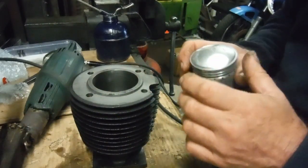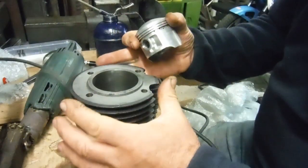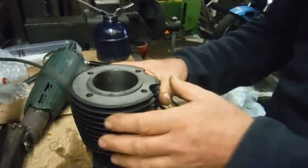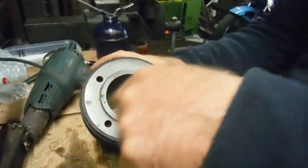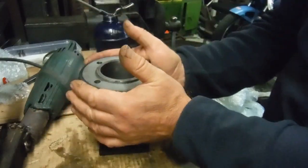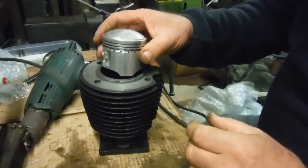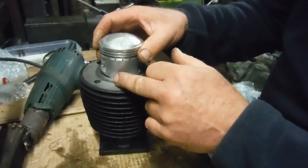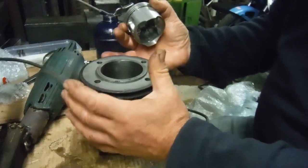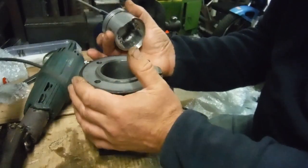This is a cast iron cylinder. Alloy cylinders seem to be less troublesome from my own experience on this front, where presumably as the piston warms up and the barrel warms up, even with an iron liner the aluminium cooling fins and jacket on the barrel can expand quicker and more than cast iron ones. When you think about it, each of these fins is a ring of cast iron clamping around a bore, and these have also got to warm up and expand before things reach their working temperatures and stabilize.